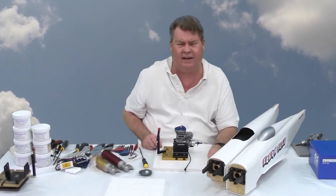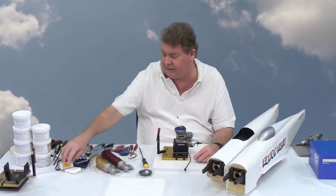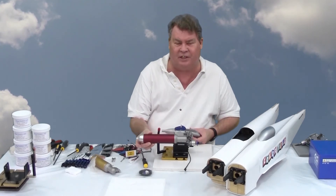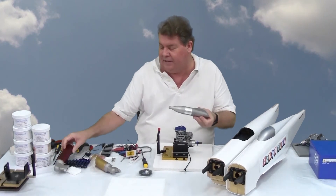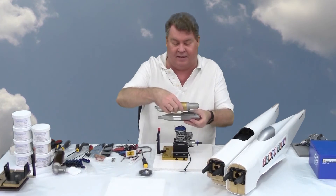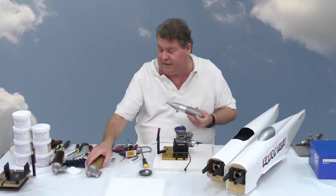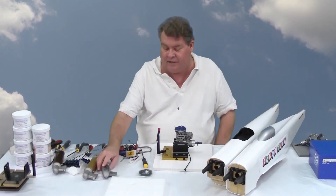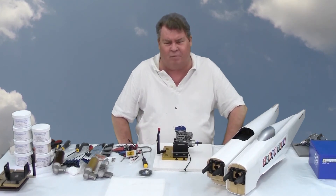It's going to be interesting to see how a gasoline two-stroke performs with electronic ignition. And it will be interesting to see if there's any power gain from the JET muffler versus the stock muffler. This other JET muffler has about the same area of internal volume, and even though it may not boost it much, it may boost it a little bit. So I'm going to be doing a lot of running of engines and a lot of building.